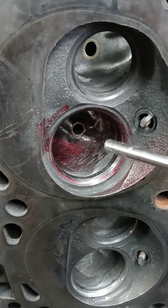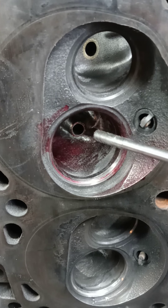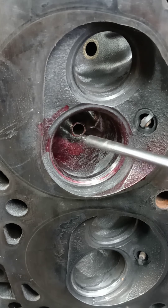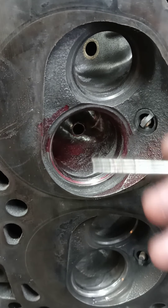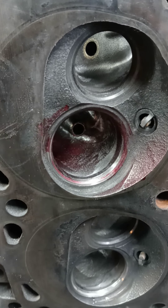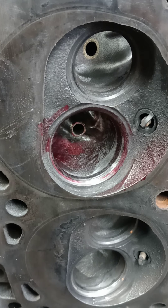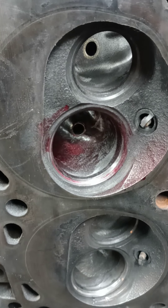I like the floor rough and I have my own theories on the floor of the intake. If you had the floor where it would chatter that fuel — and I don't mean just by using a bit like this, I mean actually chopping it up and maybe even making it a little wavy — I'd love to try that sometime. People say that would puddle fuel, but I don't mean that severe. It's one of those deals where I'd like to try it someday.